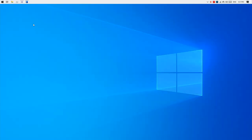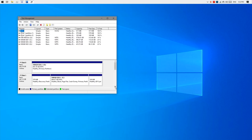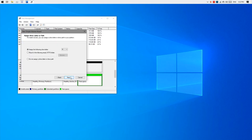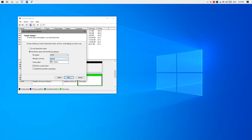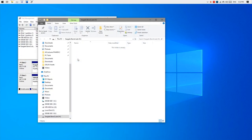Once you're in your OS, you'll want to set up the new drive before it can be used. Right-click on the start button and go to Disk Management. Find the new drive, right-click on it, and select New Simple Volume, then click Next twice. Pick a drive letter, then choose a file system — we recommend NTFS for Windows — then select default for allocation unit size and give it a name. You can call it whatever you like. Also make sure to click the Perform a Quick Format option. Once done, your new drive will appear under My Computer where you can use it for whatever you like.